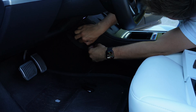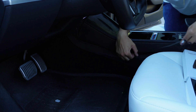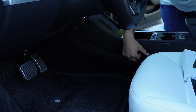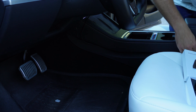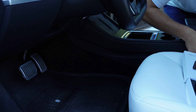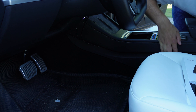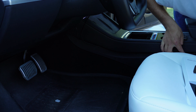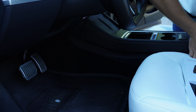As you can see where I'm installing this, I already have several different wires along the same run, so it was a little harder for me. But the wire that Hansho includes is very thin, so if you have nothing else there it should be pretty easy to hide and minimally visible when done. Run this wire all the way back along the center console until you reach the point where it feeds into the back seat — you'll be wiring into a chassis below the rear AC vents, so make sure you gave yourself enough room to reach that point.